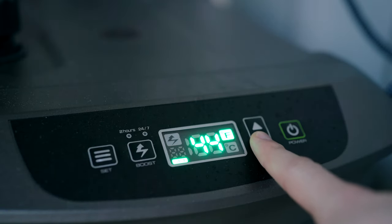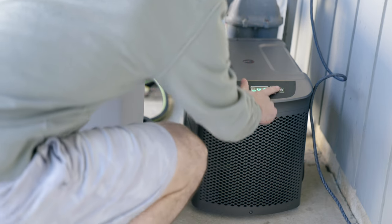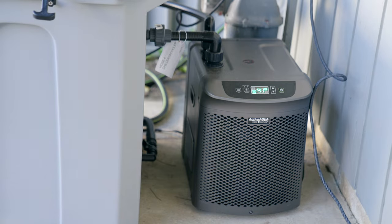On that same note, while the chiller technically gets down to 39 degrees, I personally set mine to 42 degrees or so. To get it all the way down, you're pushing the chiller to its limits — it's kind of always working hard to maintain that 39 degree temperature. However, at 42 or 44 degrees the chiller is much more efficient: it's quieter, using less electricity and putting less wear and tear on the unit. So I don't recommend going down to 39 degrees — maybe for special occasions.